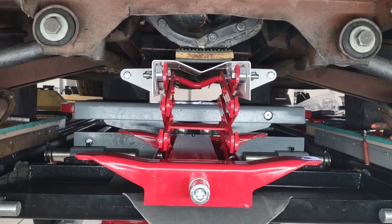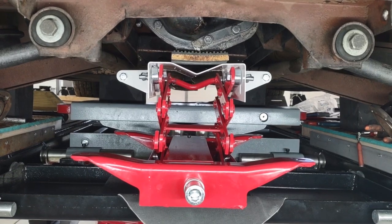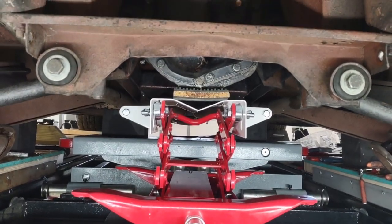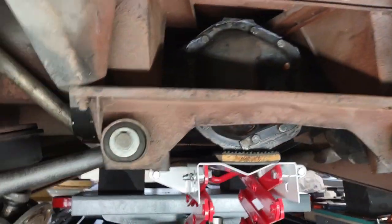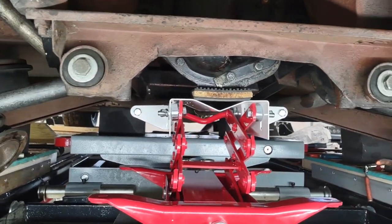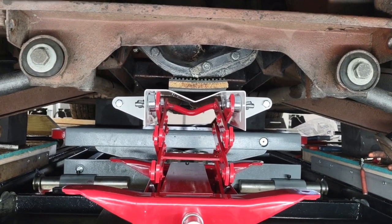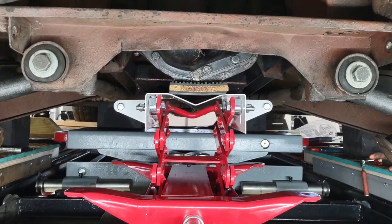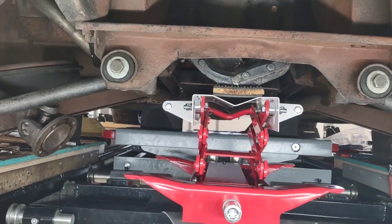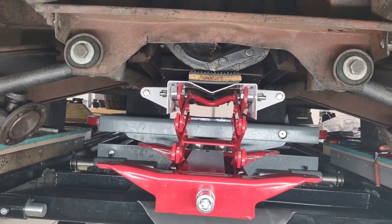And still on the bridge, there's some rubber on the bridge that I have, that way the metal to metal won't slide. I don't want that lift to slide around. I've got some rubber under the front nose of the jack, and I got one of my vibration pads in the back to take up the gap there because it wasn't exactly level, so it takes a little spacer and it helps in that respect. So I am ready to loosen the bolts and lower it down.